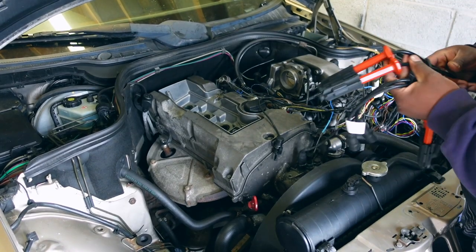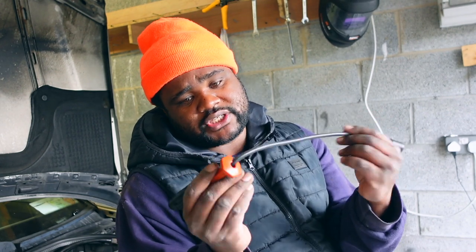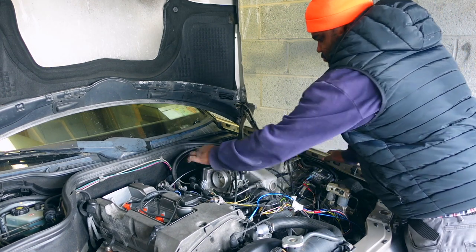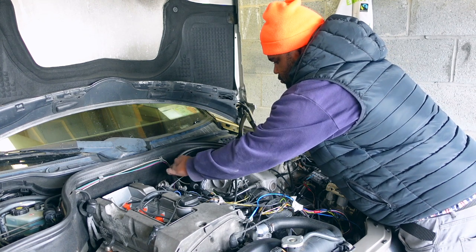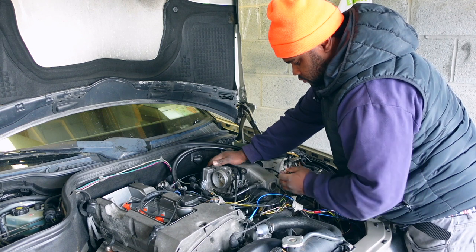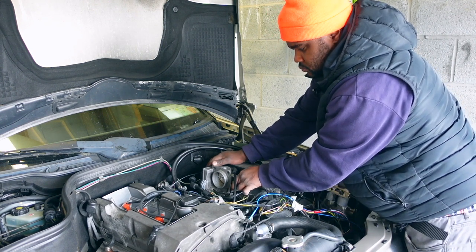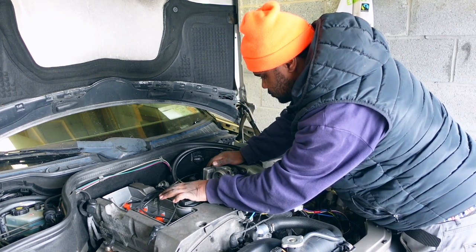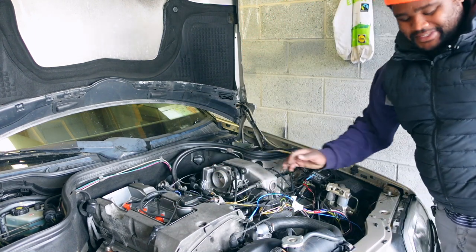They actually come in pairs, which is great. The coil packs are in, but unfortunately one of the leads is too short — I may have bought two different packs where one is supposed to be longer. I've used the other one. I've popped the battery in and I'm going to start the car to see if that fixes it. If it does, I'll move it out, swap batteries, bring the Mercedes in, and start working on the damaged transmission.